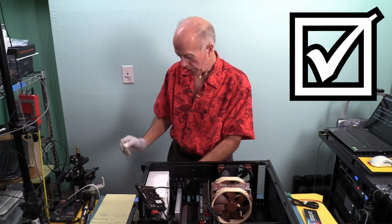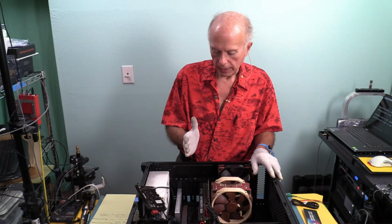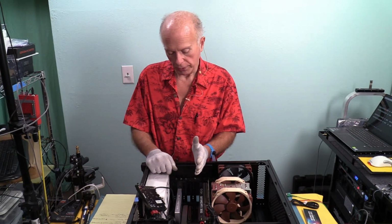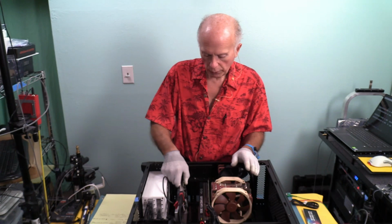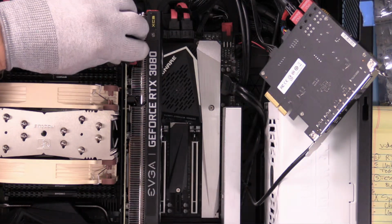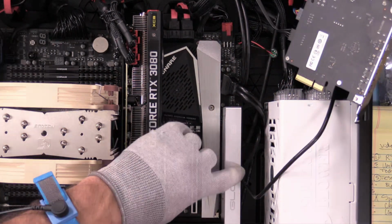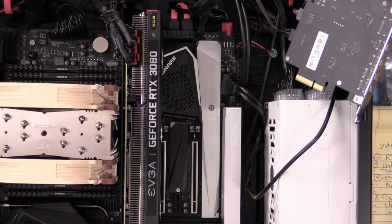That's interesting. So it's all about priorities and trade-offs. We know a 2080 Ti will fit in the case, and we have to decide what are the priorities. This motherboard's purpose is for the two I.O. cards that come with it, Thunderbolt 3, which is PCI Express 3, and the M.2 card, which is PCI Express 4. And because we've had difficulty with the root port selector, we cannot put Thunderbolt 3 in that second 8-lane slot. Change one thing, changes everything. But you cannot put an RTX 3080 with a Thunderbolt 3 card next to it. So I am of the suspicion that we are going to lose this last slot if we keep this card in here. We'll see. I never expected that to be an issue.